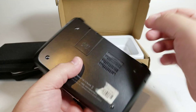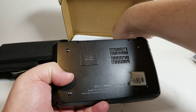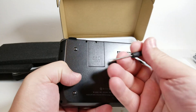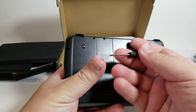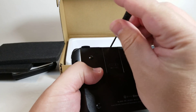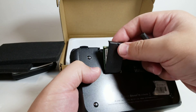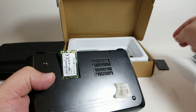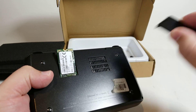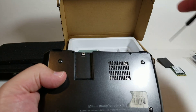Let's go ahead and begin. We're going to start by removing all seven screws around here. We're going to use this Phillips that comes in here. Now I do want to say that this Phillips will probably get worn down over some use. It's probably going to be good for one or two applications, especially when you start putting in the heatsink itself — it's going to get a bit hard. So go ahead and put this SSD aside. Leave the screw intact when you're moving it. You don't have to remove the screw on that, this will just come right out. Now you just have seven screws.